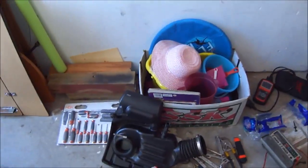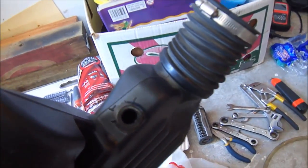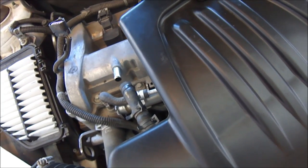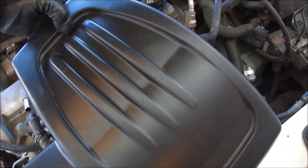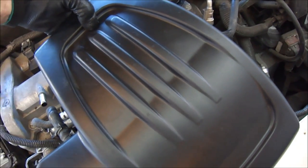So what I've been doing is I've been doing some cleaning. I cleaned the inside of this. I noticed there's a bit of oil in there. The reason for the oil over time is there's the air breather hose that comes right off the engine, sitting here, connects right to that line, and it actually breathes right into the air intake. Sometimes you get oil vapor collecting in there and it can get a little ugly. I cleaned it out with a little mass airflow sensor cleaner and then wiped as best I could on the inside.